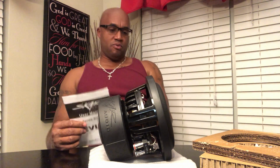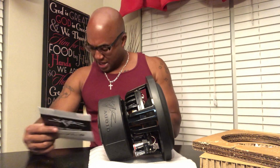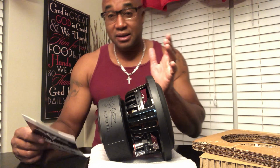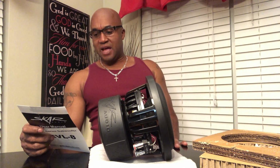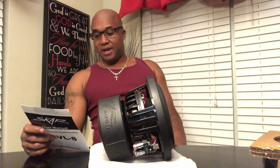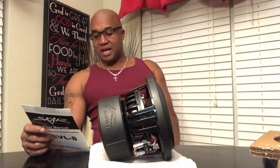Nice basket. I wonder if that basket, the traditional 7 3/8 cutout, is just slightly bigger. Okay, I got a D2, didn't I? Yeah, I got a D2, so in a perfect world I can get about 1,500 watts to it, but it's not gonna do that. We gotta see. Former core 2.5 inches. The magnet weighs 122 ounces. The resistance is 1.8 for the D2. The Vas is 2.79.